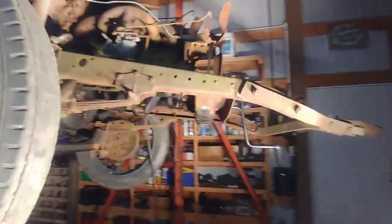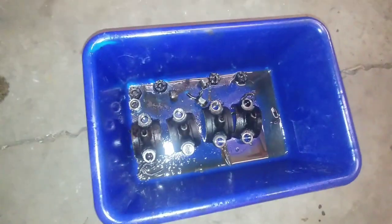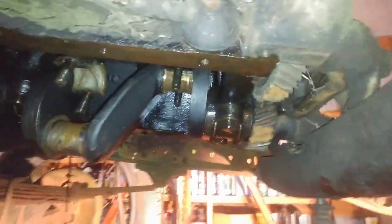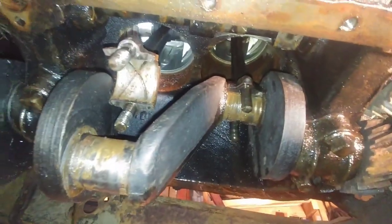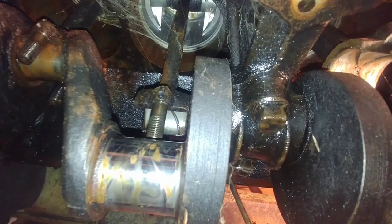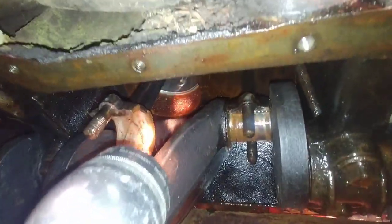Alright YouTube, got this thing in the air and pulled all the connecting rod caps off. They're ordered one through four. Don't worry - this motor is tired, there's no shims left in the connecting rods. Cylinders one and four broke loose, and you can see these other ones are still hanging. I'll hook a connecting rod up one at a time and spin the motor over to get those loose. You can see how bad those bores are.